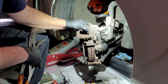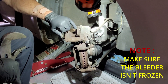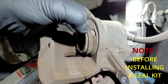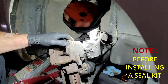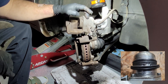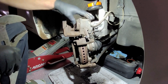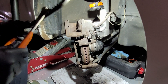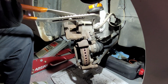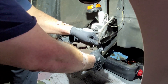The boot is torn and we have a lot of contamination inside — we're going to have to go ahead and put a seal kit on this. There's a little bit of dirt in there. If we just push this piston back, it's probably going to tear the seal that seals it with the piston. We pulled the caliper off without retracting it because we didn't want to put stress on the rotors. So we're just going to go ahead and push this back a little bit — just a little pinch — so we can mount this back without a problem.